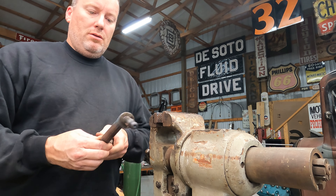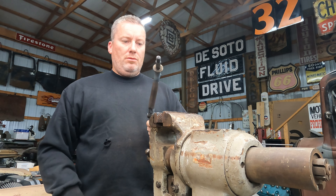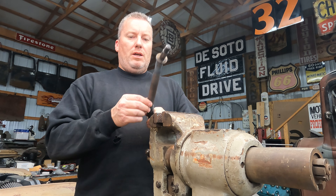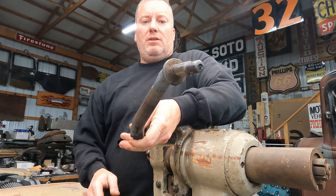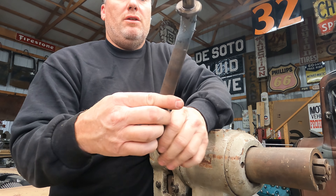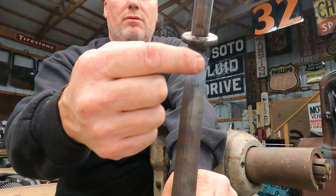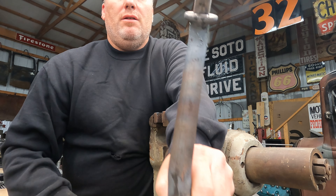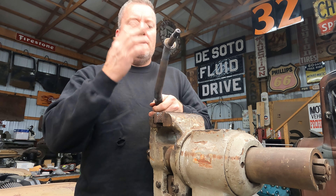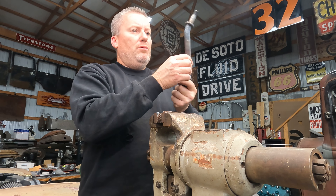From now on I'm going to try to heat it straight instead of at an angle. I've got just a little bit of twist - you can see it right there in the bottom actually, where that forged line where they cleaned off the slag is twisted. Just to keep from - not that it's going to matter because I'm going to hit it with the flap disc and you're never going to see that line again - but I think that will keep me lined up if I line it up like this and just push up instead of trying to push at an angle.